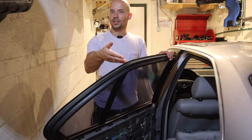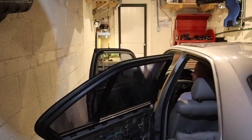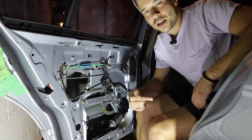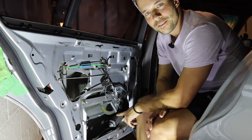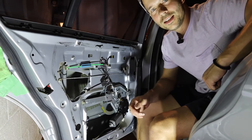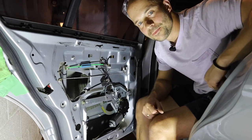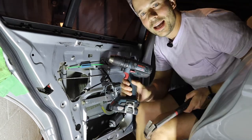Complete with the non-working rear window. I've done some troubleshooting back here — it is not the fuse, which sits under the seat. These window regulators are very prone to failing and going bad. Some genius at BMW decided to rivet these into the door frame, so in case they fail — which they always do — the poor sucker has to use a hammer and a drill.